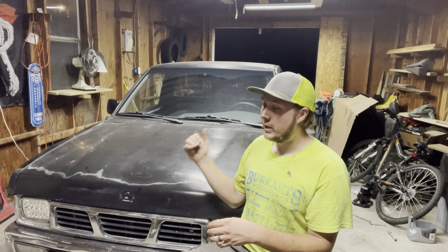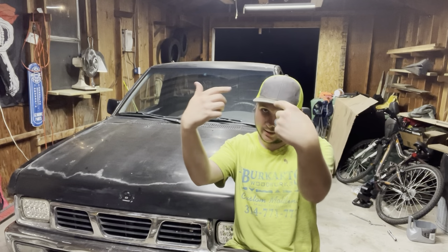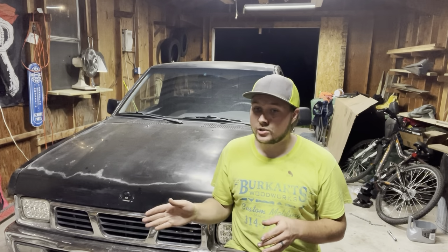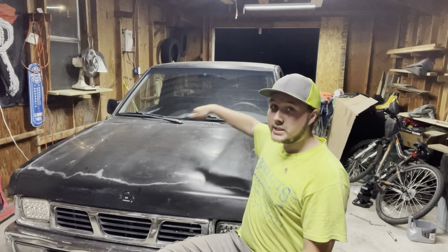The bell housing bolts, I will say, people say online you need to use a swivel socket from underneath and up in there to get those two top bolts out. You don't have to do that. Just get your standard open end box wrench. My ones have the slight offset, like the slight bend on the end. Those are perfect, because you can go right in from the top and turn those out, or you can go underneath and put your wrench on there and turn those out. That's definitely the easiest way to get to those bolts.